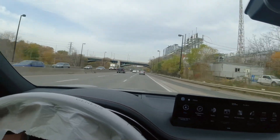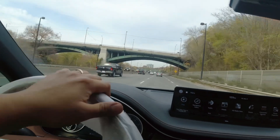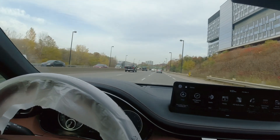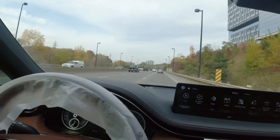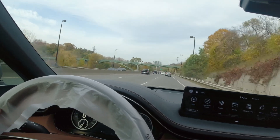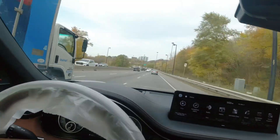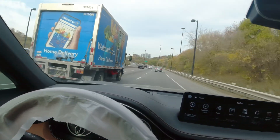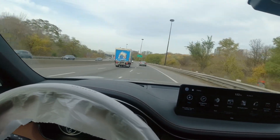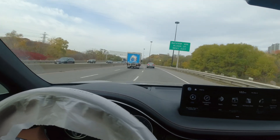I'm on the road test driving the vehicle. On this GV70 2.5, there was an option to actuate the electric water pump for the intercooler — you need to do that especially when you replace the coolant for the water-cooled intercooler, or replace the pump or the radiator. After doing the actuation test, I didn't see any leaks, which is good.